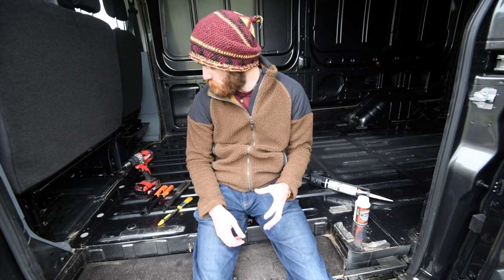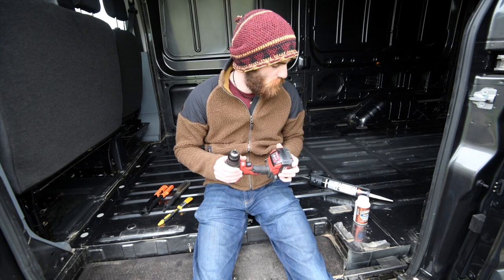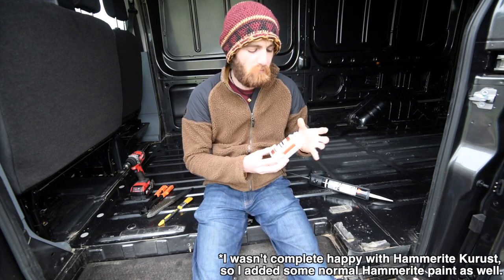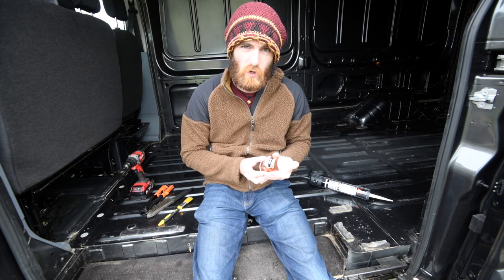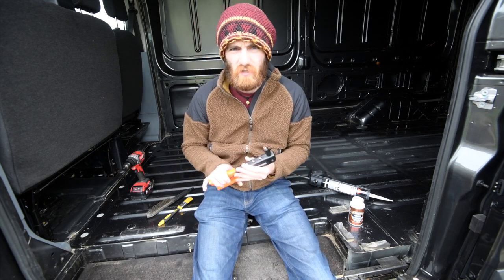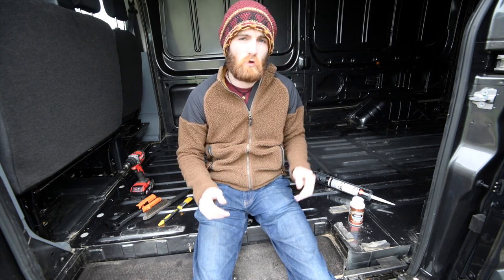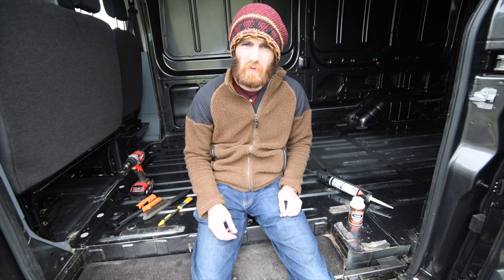Some of those holes will be ragged because they've been made with self-tapping screws, so I'm going to use the drill and a 4mm drill bit to widen all the holes to make them clean and even. After that we're going to wire brush and clean all the rust away, then use some Hammerite Krust — a rust converter — so any remaining rust will be converted to a stable material. Then it gets a top coat, and to fill those physical 4mm holes I'm going to use pop rivets, then a little bead of silicone on top. That should do a good job sealing the floor. After that just touching up any other scratches, because there are quite a few wear marks on the ribs where the previous floor and grit have rubbed away the paintwork. That's today's plan.